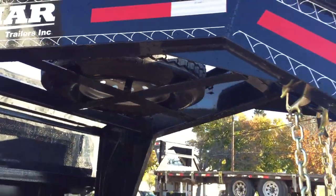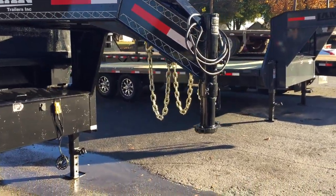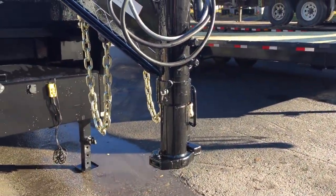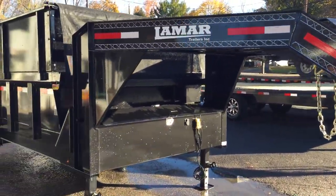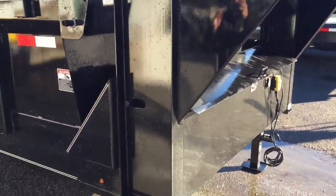Up in the neck you'll see a spare tire, which comes standard on gooseneck dumps, and the gooseneck is adjustable with four different adjustment positions. Of course you have your safety chains and seven-pin plug. One nice feature I like about the dump design are the neck gussets — they give extra strength to the trailer.